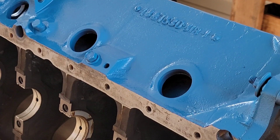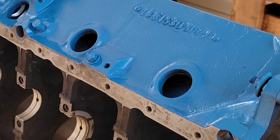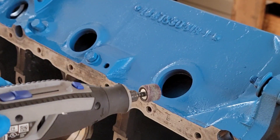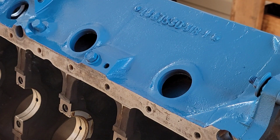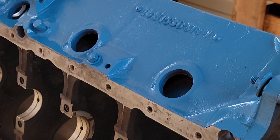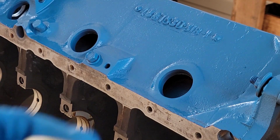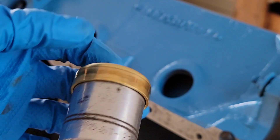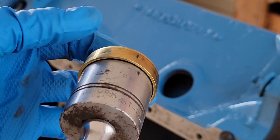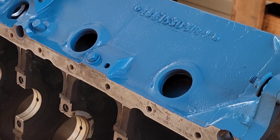A few tools I'm going to use: I'm going to use my cordless Dremel just to clean up the inside of the freeze plug holes. I've got some red RTV we're gonna smear on, and then we've got an inch and an eighth socket and an extension that fits pretty snugly — we'll use that as our driving tool — and then a two-pound hammer.